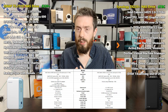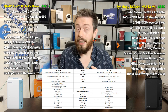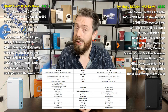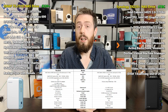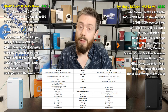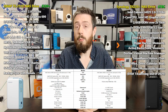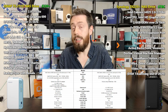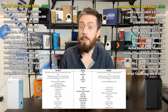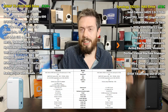The QNAP's CPU is still very proficient and very close — it's the J4005, a dual-core 2.0GHz processor that can burst up to 2.7GHz, so quite close but not quite as high. It also arrives with 2GB of DDR4 memory. However, the Synology can only be officially upgraded to 6GB — oddly, a 2GB stick and a 4GB stick — while the QNAP can officially be upgraded to 8GB. We have already unofficially upgraded the 251D to 16GB of memory and it did function, though CPU limits do have to be factored in.